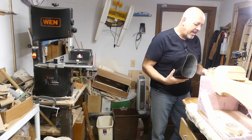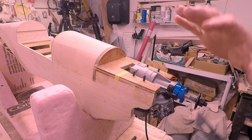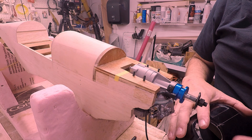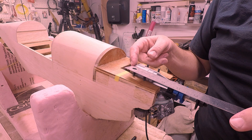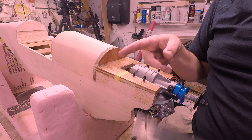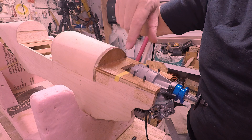So what I ended up doing was coming in up here on the top. This had to be at 166 millimeters to this part up in the front. And I wanted to stand off about an eighth of an inch, so figure about another three millimeters - that should come out to about 169 millimeters. I measured the length of the motor and used the backing plate as an indicator. This was sitting at 109 millimeters, so I knew this had to be 60 millimeters off the firewall. That's where the tape is set up - this line right here is 60 millimeters. In theory, this should be in the proper location sticking out.